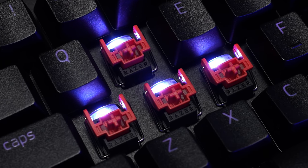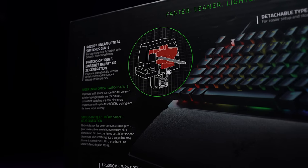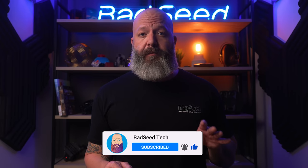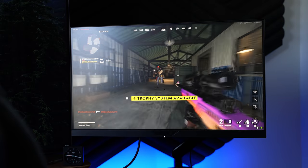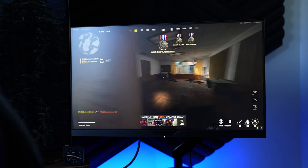The big draw for the Huntsman line is the Razer optical switch. Both boards now offer a choice of Razer's purple clicky optical switch or the V2 version of their red linear optical switch. There is debounce delay associated with mechanical switches — it's usually guaranteed by switch manufacturers to be under 5 milliseconds. Optical switches are not affected by this, so they're fast. How much faster than regular switches is usually determined by specialized hardware, software, or kids on Adderall.